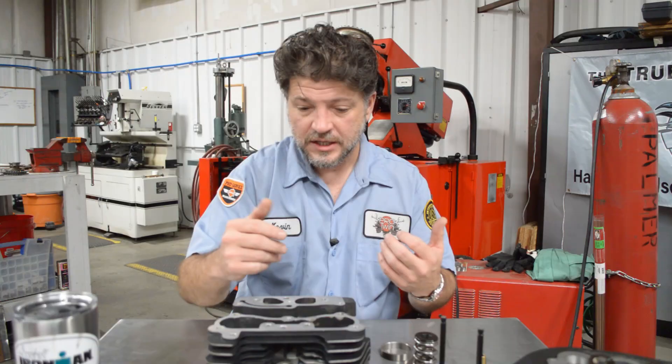And then once the head is assembled, there's another step of that process. It's actually putting a fixture on top of the cylinder head and simulating where the valve position would be at top dead center of that exhaust stroke, so you see exactly the clearance between the two valves. You literally press the valves open based on the cam specs at TDC lift, and you know that's the moment the valves will be closest to each other. Then you measure that clearance between the two valves.